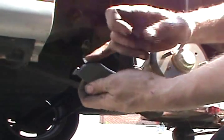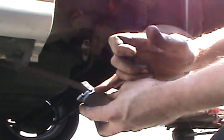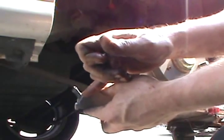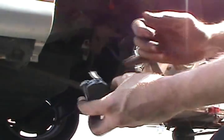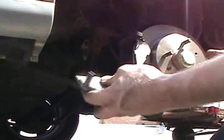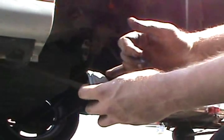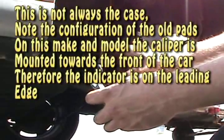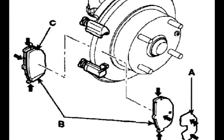Put your inner pad on — it's usually the one with the squeaker indicator. As you can see it's set to about 3/32nds; usually that's about when you get your brakes changed. Anything beyond that won't pass inspection anyway. Point the indicator upward — that way when it comes around going forward it's correct. Otherwise you'll bend it back out of the way and be like, that noise went away, I don't know what that was.